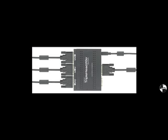Installation of the TripleHead2Go was very easy. I simply hooked up all the signal cables and fired up my PC. Upon the first boot, Windows XP recognized a 3840 by 1024 desktop natively, and everything worked fine. From there, I installed the SGU, the Matrox Power Desk, and the firmware update to make the center monitor the primary monitor. Gaming with the TripleHead2Go is an amazing experience. The field of vision is completely immersive, and the name Surround Gaming is certainly a good description. Half-Life 2 and Lord of the Rings Online are two good examples of how Surround Gaming can best be experienced.